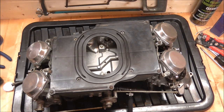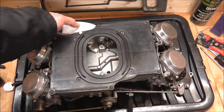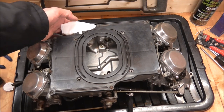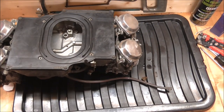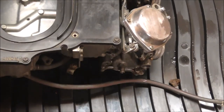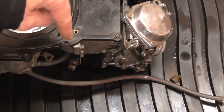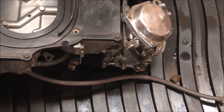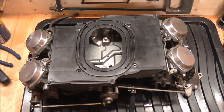A little tip from a couple weeks ago when I replaced the choke cable - I've drilled a hole in there. I drilled it when it was actually on the bike. If you turn the whole lot round, you'll see it more or less lines up directly with where the choke cable connects, so when this is on the bike you can actually get a screwdriver down in there and release the choke cable. That's the end of this video. A third video is going to be putting it back on the bike, and if you haven't seen the first video, that was disconnecting it and getting it off the bike. Thanks for watching.